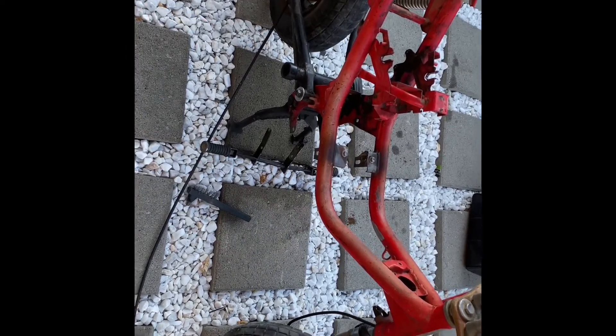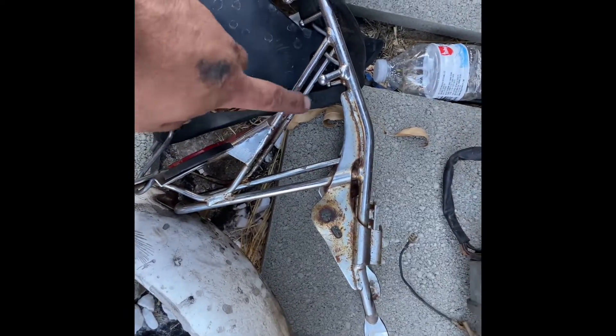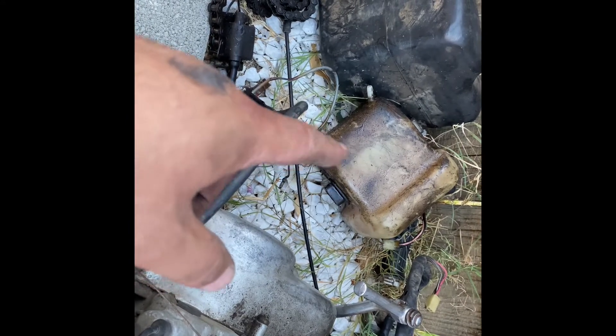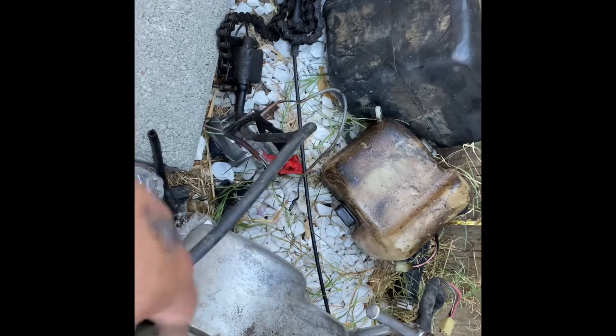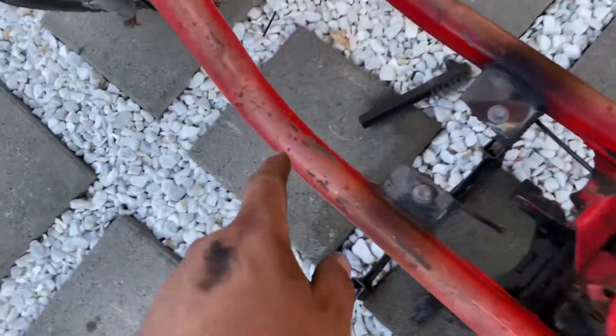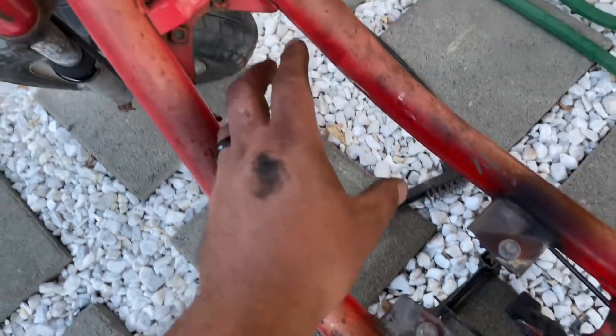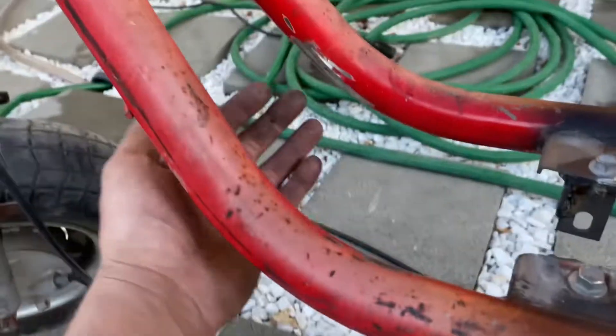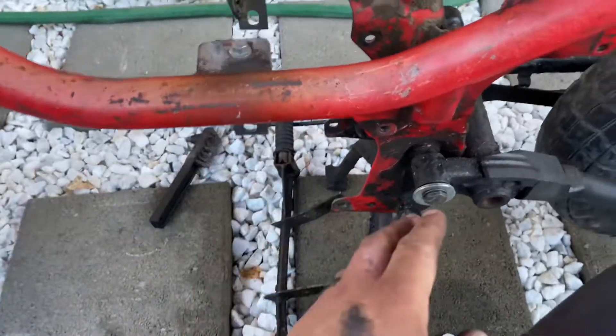We'll prep for paint and continue on with the build. Over here is all the stuff we stripped off: the fender, the rear rack — we might redo that in something other than chrome. There's the stock two-stroke motor it came with, the harness, the old chain, old harness, everything — including that injection system where they use the pre-mix and gas separately. Getting rid of all that. I also had to remove a little tab plate right here where the motor sits, because the head sits here and the intake manifold comes up right here with the air filter, so I need that spot clear. I ground it on both sides, took off that plate, and got our mounts all done.